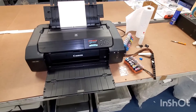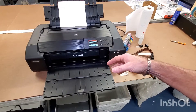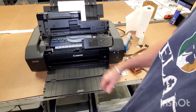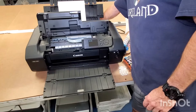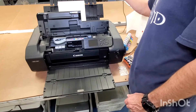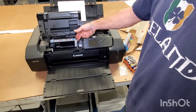Next we're going to get to the installation part of the process. First, the machine needs to be prepped a little bit. As you notice, there are no cartridges showing in the machine — I've already taken them out, but this is what you want to do. With the machine powered on, go ahead and lift the lid. Cover's open, and then you want to kill the power. When it starts to move to the center, I just go ahead and pull the plug. If it's not convenient to get to the power plug, just pull it from the back of the machine, whatever is easier for you. Now we're going to slide this to the center, to the cartridge change position.